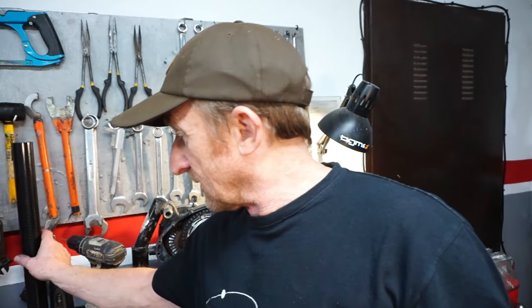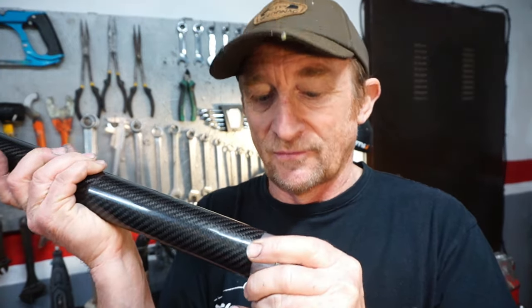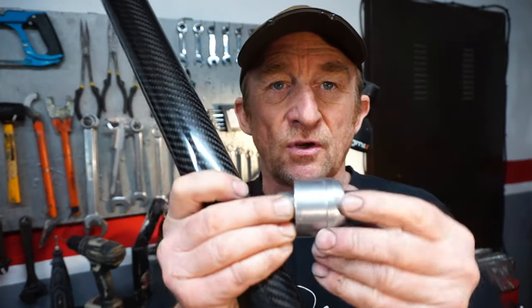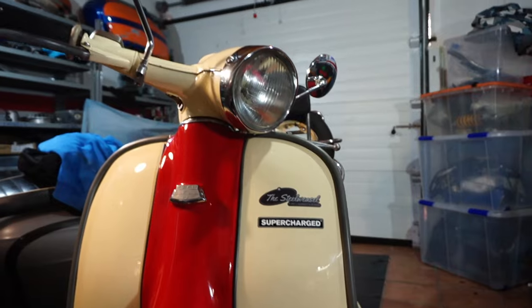So far, we've got the back end pretty well polished up. That goes into our carbon with a load of packing and stuff. It's a nice tight fit, almost a press on fit. It'll go on with some sealant, and it's hard, and I'm going to only fit one rivet at the back because this has got so much shoulder on it, it's not going to need any rivets in it. Once it's pushed on with the adhesive, it's never going to move.